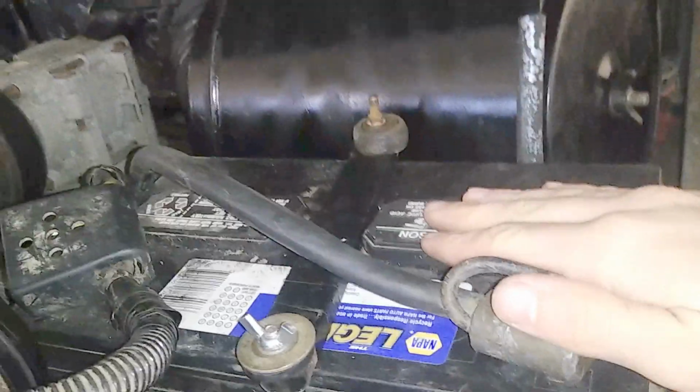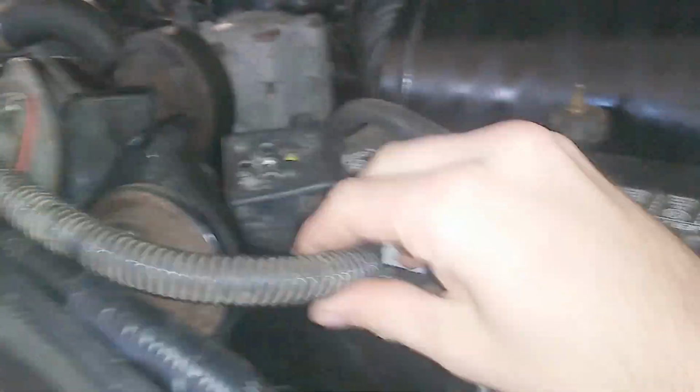You'll need to keep the big cable for your battery connections, obviously. I also recommend keeping the starter relay. It makes a good place to attach battery connections, and it only takes one 12-volt wire from the start circuit in your factory wiring to crank the starter.